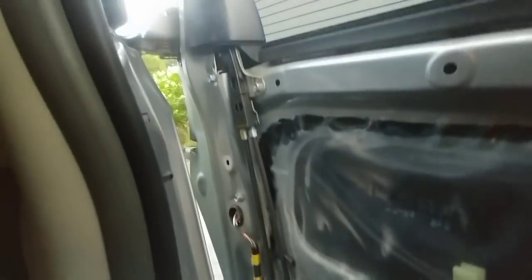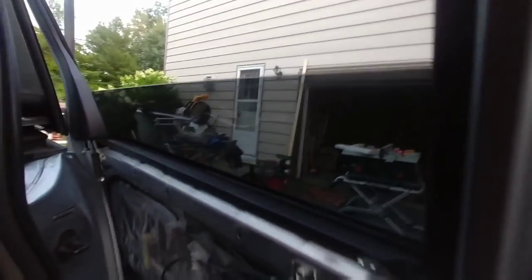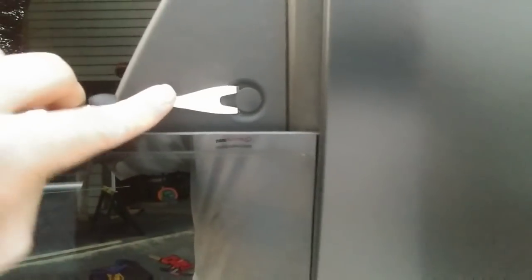I've got the whole panel off and set it inside the van. Now I can see the pulley system — the broken cable is in there but it's stuck behind a plastic piece of molding. One important thing: before you disconnect power to the window, make sure you put the window down so you can access this little hidden spot that holds the molding on. I'll pry that off and show you what it's all about.